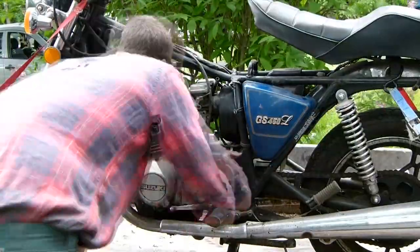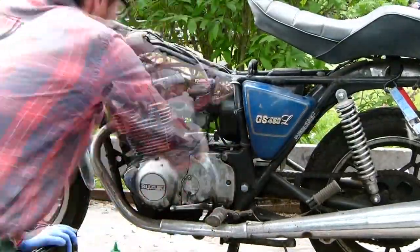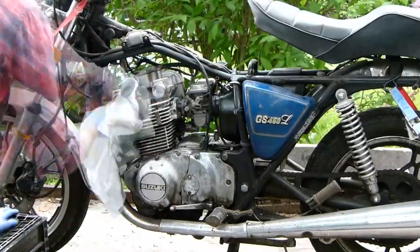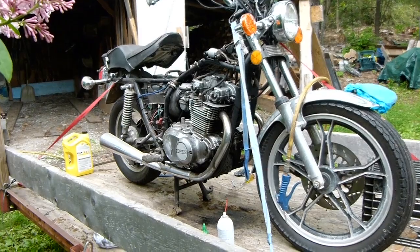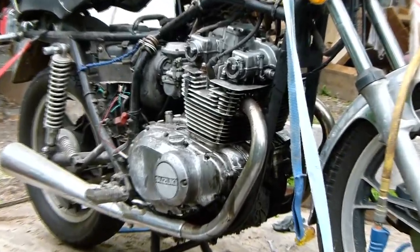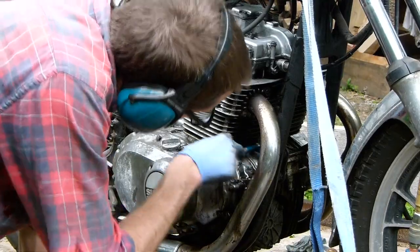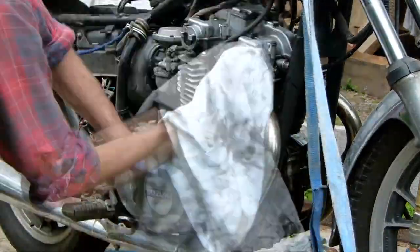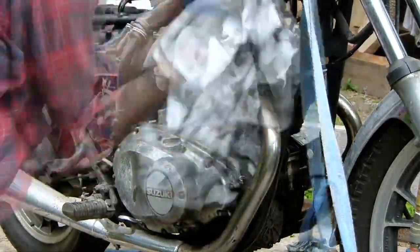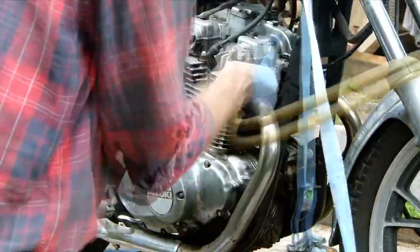So I'm going to get the gas tank off, get that drained of the old gas, take a look at the carburetors, clean up all the grease, oxidization that's occurred, clean up the chain, tire pressure, all that. Got a new battery for it, got a new oil filter here. Yep. Change the oil, got a couple spark plugs.